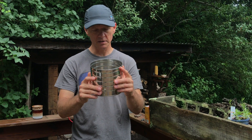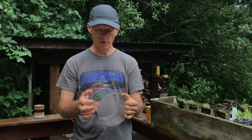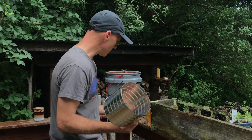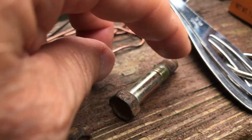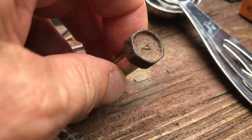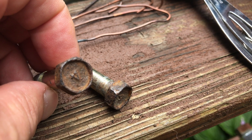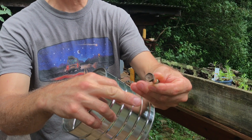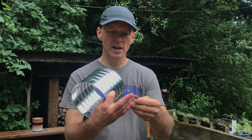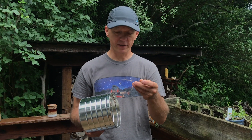I used coffee cans like this as my anode. This is going to be the magnet, quote unquote, so it's going to attract the rust from the item you're trying to remove rust from. I grabbed a couple of other bolts out of the van just to use as an example. Like this bolt — the head is rusted, it still has zinc on it with a good chromate finish, but there's rust on the threads and rust on the head. This is a great way of pulling rust off of different items on your vehicle so that you can refinish them.